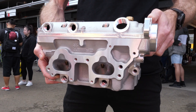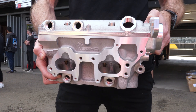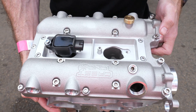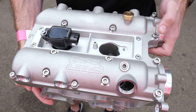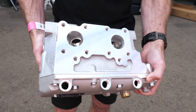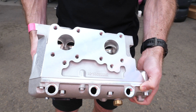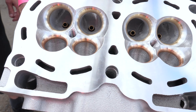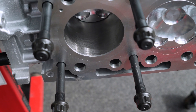When you were starting with a clean sheet of paper, it gives you complete flexibility — port shapes, designs, the valve train itself. What have you decided to change with this cast head? With the Subaru we were able to move the intake ports and valve further apart, so we managed to get a 42mm valve in there, also being able to go up to 420 CFM on the intake.